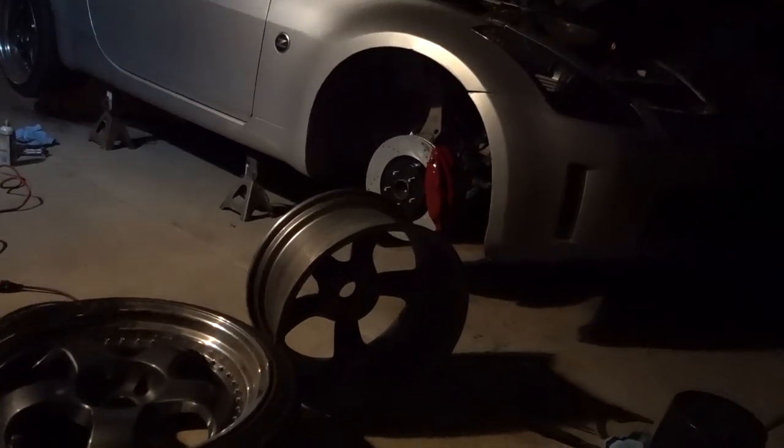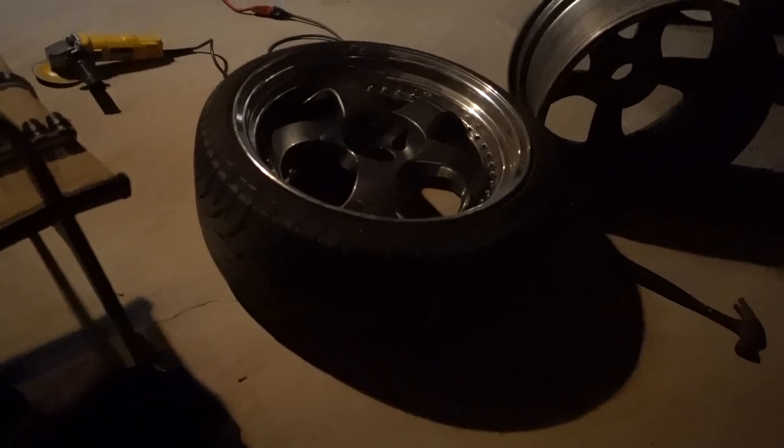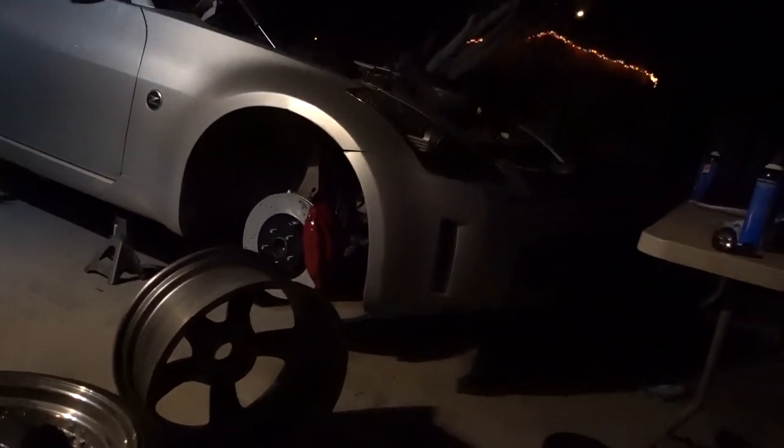We tried his stock wheels, they don't clear the back part of the caliper. The aftermarket wheels don't clear the front part of the caliper. So I don't want to shave the caliper, not until I'm out of options. So I think what's next is some little 5mm spacers for now and some extended wheel studs, and hopefully in due time, I'll be able to buy proper wheels that will fit a big brake kit.